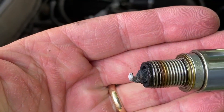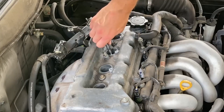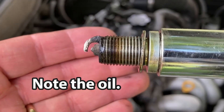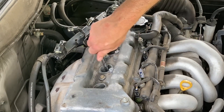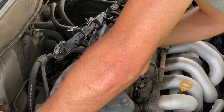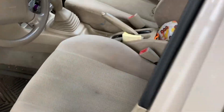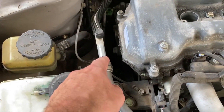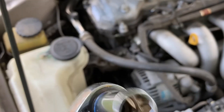Yes, they're pretty ugly. And yes, I do have new spark plugs to go in here, but I'm not going to change them yet. Now I'm going to make sure that the brake is on and the car is in neutral. And that is so we can put a wrench on the crankshaft pulley and raise and lower the pistons so we can see the cylinders better. It's a 19mm we're going to use on the crankshaft pulley.